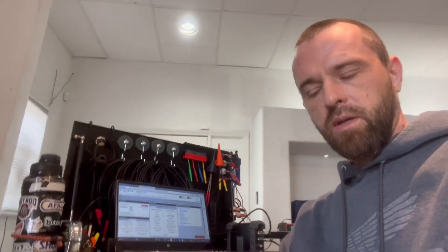Today we've got a 2012 Malibu with a pretty common issue - the P0010 for the intake cam actuator. If you're watching this, you're probably wondering how to fix it. It's typically the solenoid, dirty oil, or the screen on the actuator is clogged. A lot of times it's a sensor, but let's figure out what's going on and pinpoint it.